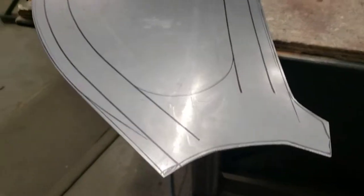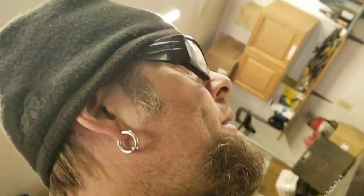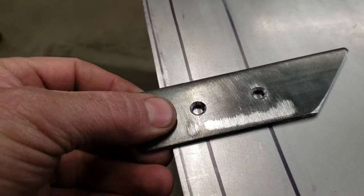I've got the lines all the way around and put a radius on the step die line so it's continuous. I also ran this through the English wheel just a couple of times — there's a slight rise in the material, so pre-stretching it makes it come out a bit flatter. If your line gets rubbed off by the English wheel, the jig lets you re-mark everything nice and uniform. Super quick and easy to make — just two holes, a couple tacks, done.